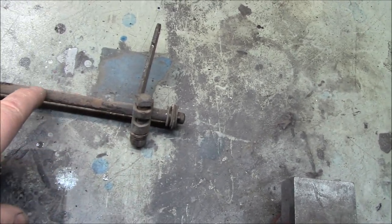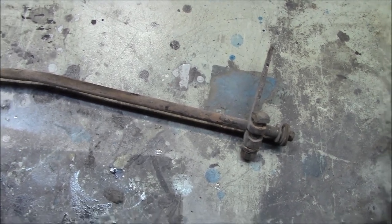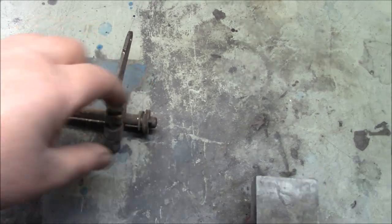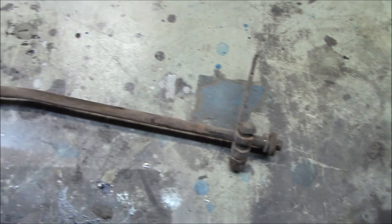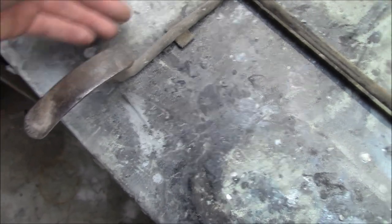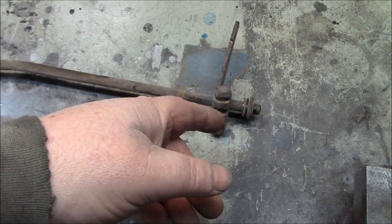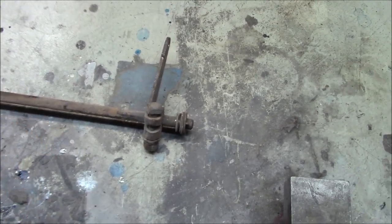One quick note as well: when you're painting these — and I found this out on my TR6 and TR3 projects — it's probably not best to paint the entire shaft initially, because you're going to end up sliding bushings across it and you'll strip all the paint off the newly painted area. So we'll probably just paint the bottom part up to about here, leave the rest unpainted, and carefully paint it once it's back on the car.